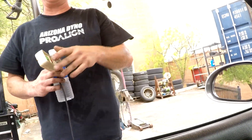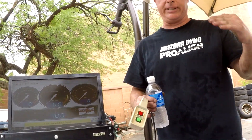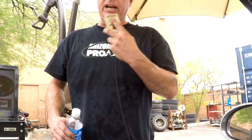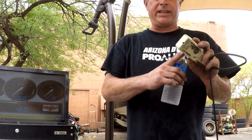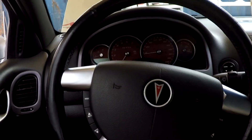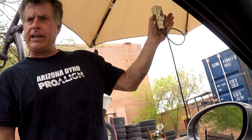When we get to fourth gear, we're going to hold it steady at 2,000 RPM, not accelerating or decelerating, just hanging out. At that point I'm going to say 'Josh, are you ready?' You're going to say 'yes, Keith, I am ready.' I'm going to press the screen button to start our data stream, check it, make sure it's working, and once I know it's working, I'm going to say go. Please wait for me to say go — so when I say go, nail it, stay in it. Bring it up to your desired RPM limit, lift off the gas, put it in neutral, go for a coast. I have the brakes — I've got railroad car brakes working underneath this. If you get in a brake contest and I win, I flat-spot your tires; if you win, you snap the straps and hit the big fan and we'll provide you with a box and mop for your inconvenience. Remember, if it feels weird, it is weird.